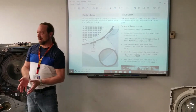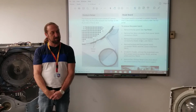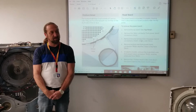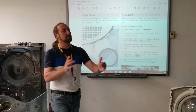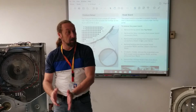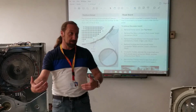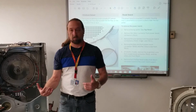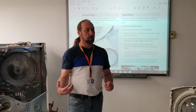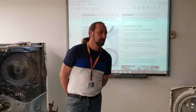Is there a disadvantage to automatic dry? Yes. Give me an example. If it's not dry, it will stop. I said, is there a disadvantage to automatic dry over time dry? In other words, is automatic better, or does it have its problems too? It's better, because as soon as it's dry, it'll stop. Okay, but what is the problem you think it'll have? The clothes can still be wet, versus time dry, where you have a set time and let the clothes run.